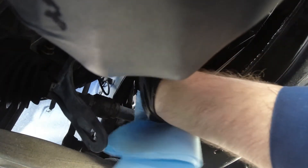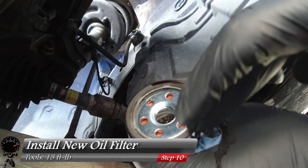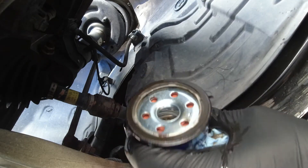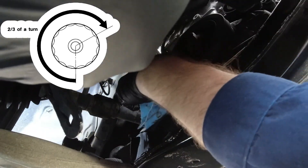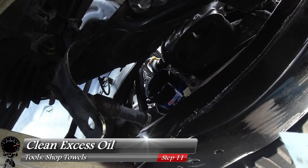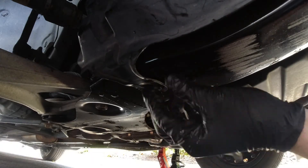After a few minutes have passed, let's clean up the area with a shop towel — we don't want any dust or debris near the oil filter housing. Now we're ready to install our brand new oil filter. I'm going to dip my finger in a little bit of oil and apply a nice thin coat on the rubber ring on the outside, making sure it's evenly distributed. Now we move the cover aside and thread the filter right on the same way it came off. Once you make contact with the engine, you want to do an extra two-thirds turn — I'll use a shop towel for a better grip. Then clean up any excess oil. Let's reinstall the retaining pin — just line it up and give it a nice push until it's secure.